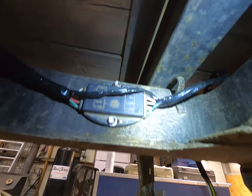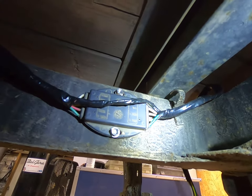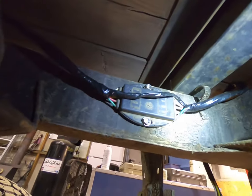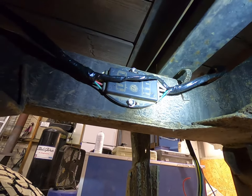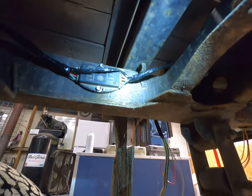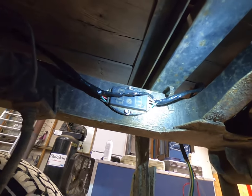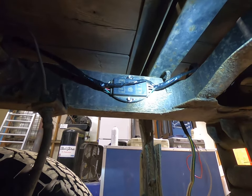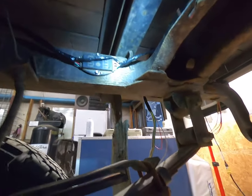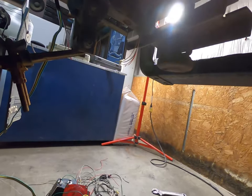I got the converter wired in here. I wired it directly inline and now I've got four wires coming out the back. The wire running across the top is a ground that I'm going to run to the frame. The other wire in that bundle is the reverse wire, so I can have all the backup lights working as well. We'll get these lights over here wired up and then we'll be good to go.